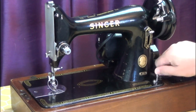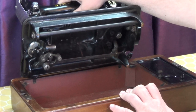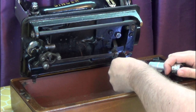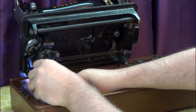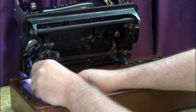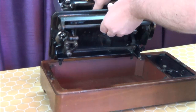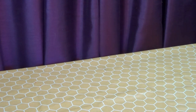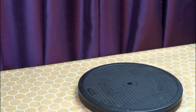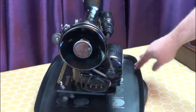Next, I'm going to remove the machine from the base. Just tip it back and loosen the grub screws that hold the machine to the hinge pins, then it should just lift off. You may need an extra pair of hands to help you here. I like to use a cheap turntable with an old plastic tray to work on. The turntable means you can move the machine around easily, and the tray will catch any small screws and later any drips of oil.